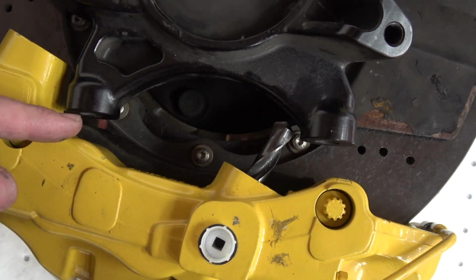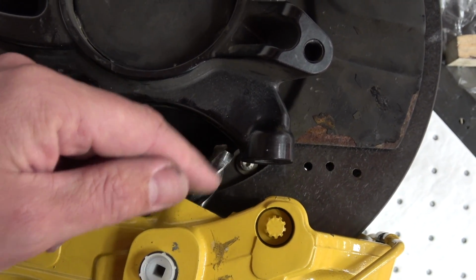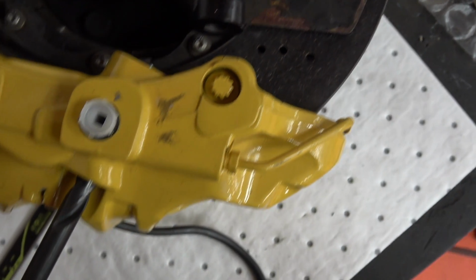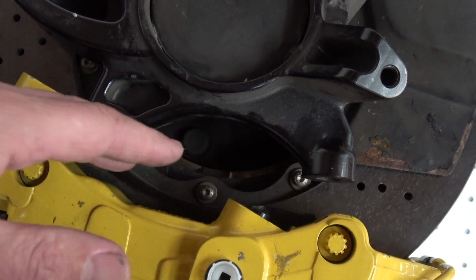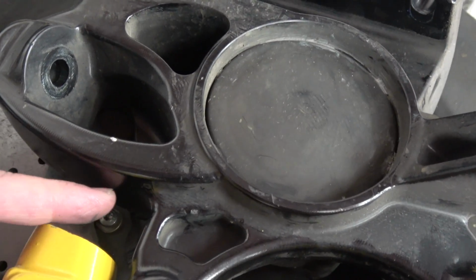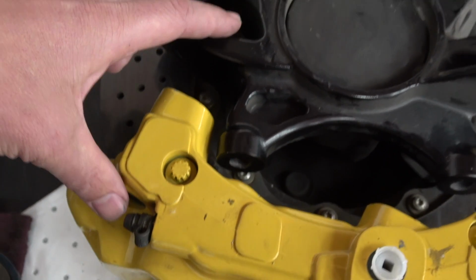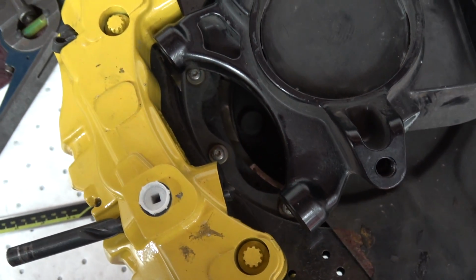and it's going to start with just a simple piece that goes straight between the two mounts on the upright and give me one bolting point here. This drill bit is just in for reference, so I could do the measurement. But yeah, basically one bolt will come out through there, mount this in, and then I can level everything up again and see whether I want to extend this conversion plate that we're going to make, or whether I actually look at just drilling and tapping into the knuckle itself, which is a really meaty bit here on the knuckle, and creating a spacer that I'd probably weld in place as well, just for a little bit of extra strength. But basically it would allow it to pinch and bolt in nicely. But yeah, first of all, got to do the drawing for the thing that we're going to 3D print.